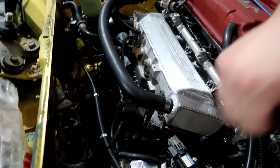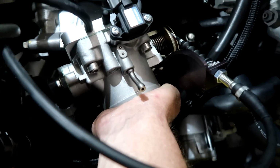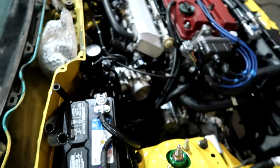Yeah. Okay. It's still pulling air. When you shut the door, I know somebody's going to comment why you do that. If you put your hand over the throttle body, you should shut the motor completely off. If it doesn't, it's pulling air in from somewhere. It does give you a nice hickey. It won't hurt you, don't panic.